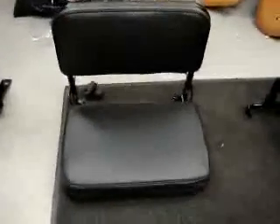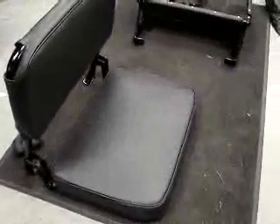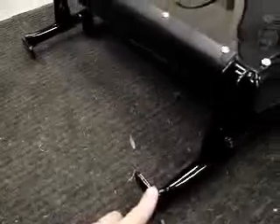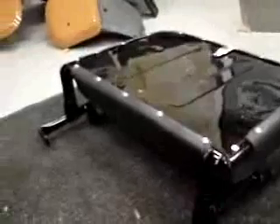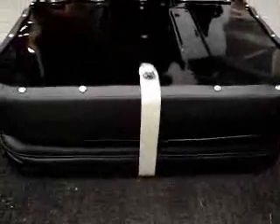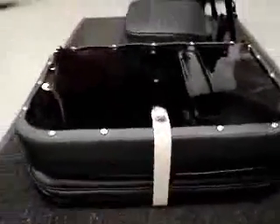These seats work very well. I'll put the camera down and open up the seat now. You can see the seat is nicely upholstered. There's quite a bit of work done on the seat in order to reuse them — there's new steel welded in here, and some reinforcing was done on the welds in this area, which is typical because they are often taxed. One of the last things to go on will be some rubber cushions right here that, when folded down, will rest against the wheel well of the aluminum body. This is a nice canvas strap, mimicking the original canvas strap that was there.